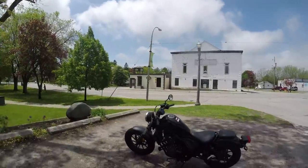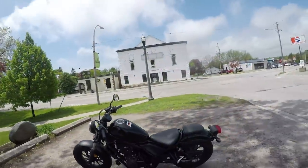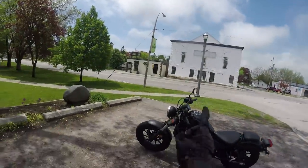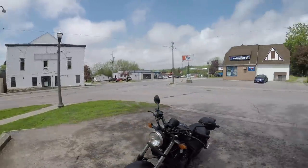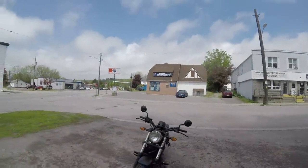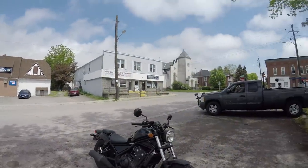What about performance? This is the Rebel 500. It has a parallel twin from a CBR 500R, and that is good — good to about the tune of 45-ish horsepower, and that's important for the highway. This comes in the Rebel 300 as well, but it's too slow, too vibrational, and you want this one with the power in it.